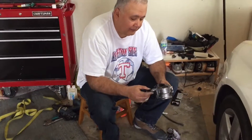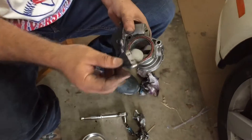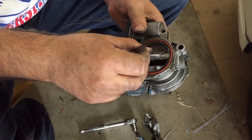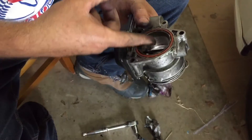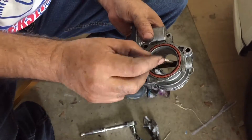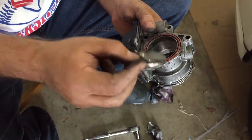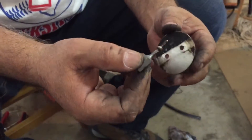Okay, we got this plate right here. Two screws and we took it out. So this thing is still going to work, but when it closes there's nothing to close — it's going to be clear. So it's not going to send the fumes to the EGR. This is how it's going to work — these are the two screws that I took out from here.